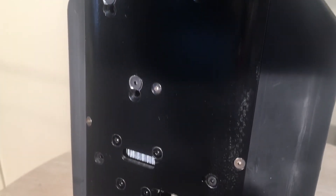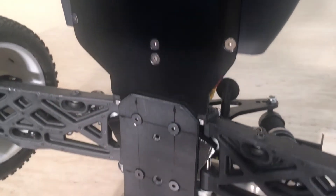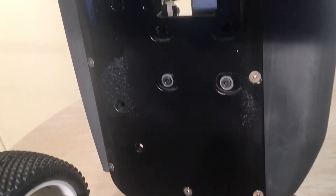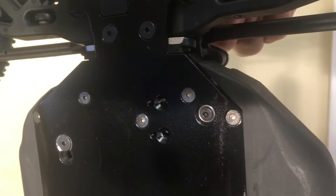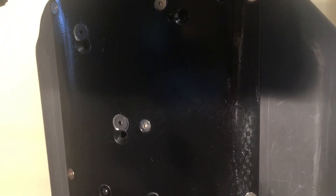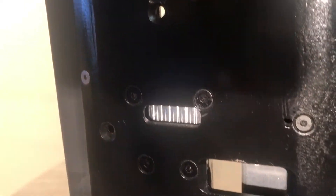So that's it on this one, y'all. This is a Losi 8T converted, my way. I just shifted the receiver box up. I'm going to show y'all the bottom of it. So that's the bottom — just shifted it up, redid the holes. Made that T-Bone Racing Willy Bar fit. All you had to do was just move this up just a little bit, as y'all see — those two holes right there. That's all I had to do. Can't even tell. Came out nice.